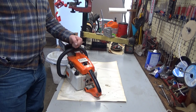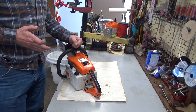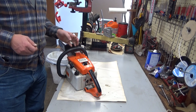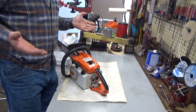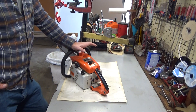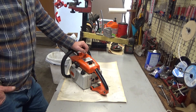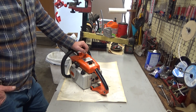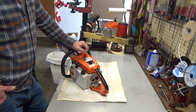I initially got it back from Jay — he indicated that it would start, run okay, but when he would tilt forward and make a cut, it would die out. So I put in crank seals, took it up to test, and thought I had it. All of a sudden it started running super erratic, leaning out, and no amount of adjustment on the carburetor would bring it back.